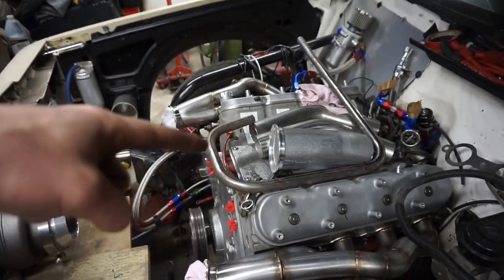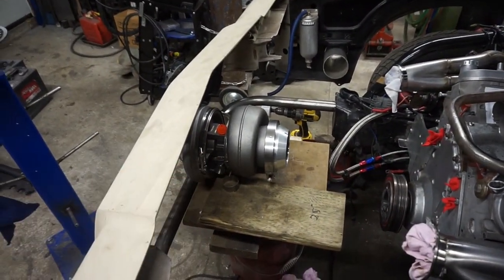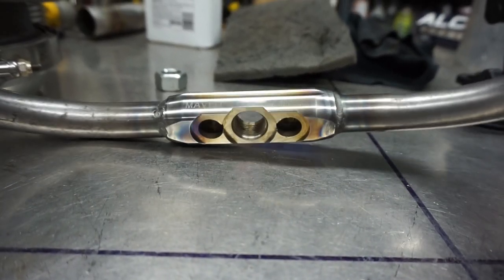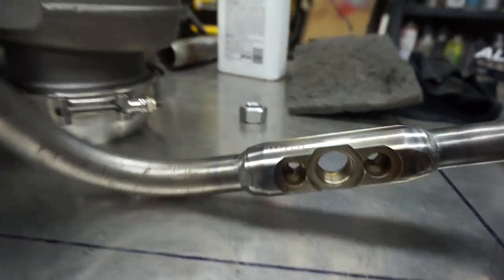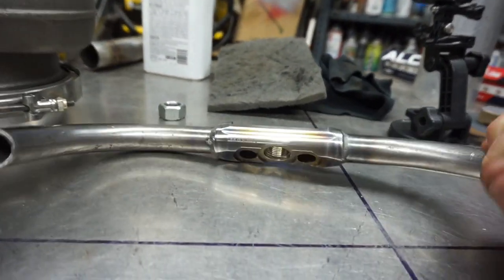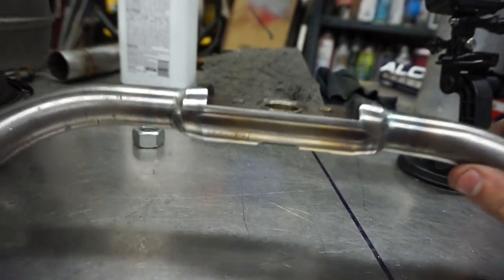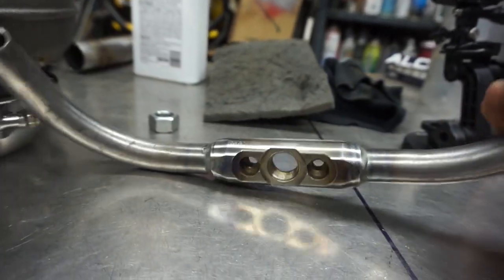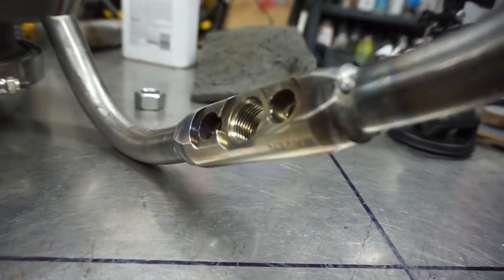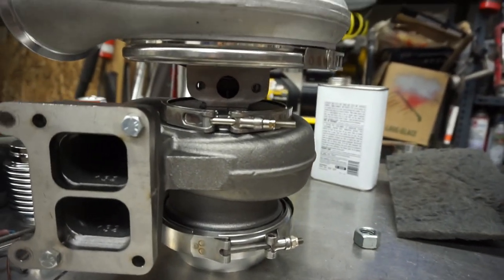Just bent up some tubing. I'm going to cut the 90s off and then just shape them to fit inside the frame. There's a quick close-up of the mount — it just bolts right up to your drain tube on your turbo and then you mount off of that. It goes from one inch up to an inch and a quarter. I used one inch, so it has an O-ring on it, and it's already tapped for a dash-10 or whatever you want to go to. So next step, I'll bolt that up to the turbo and then I'll get it mounted onto the frame.